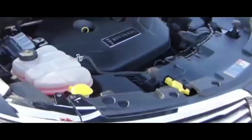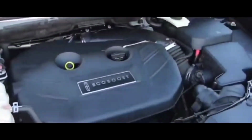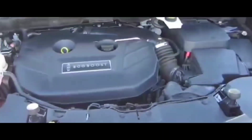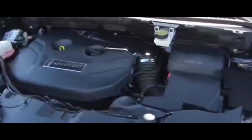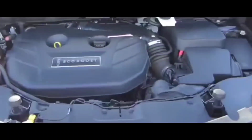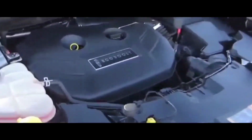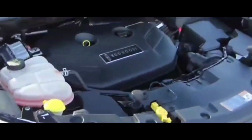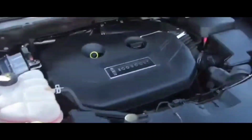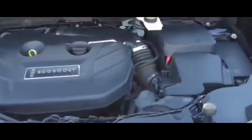You're going to want to leave your car at idle for at least 10 minutes, which will give your ECM enough time to learn any new modifications installed on your car. Because the auto ECU is such a sensitive device, it is very important to reset the unit after modifications are installed, or else the new modifications could conflict with the way the engine performed previously.